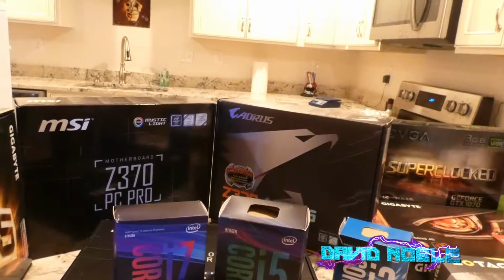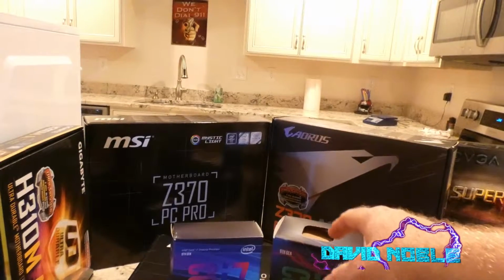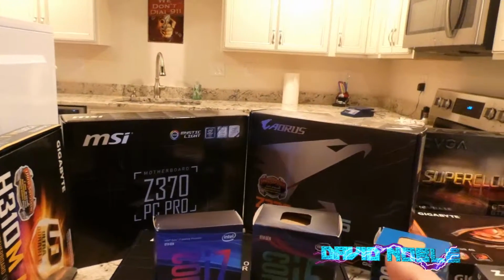Thoughts on if you really want 9th gen, like I said, get the Z390. If there's another board that you have, then you're going to have to get an 8th gen chip. Try eBay, buy an 8th gen Celeron.